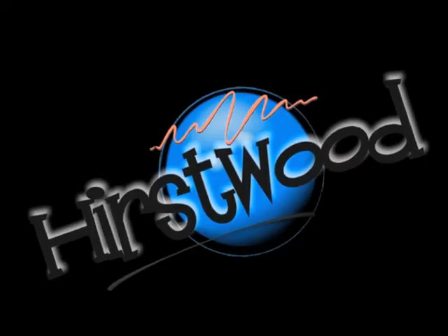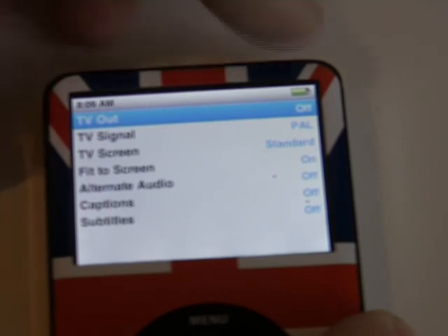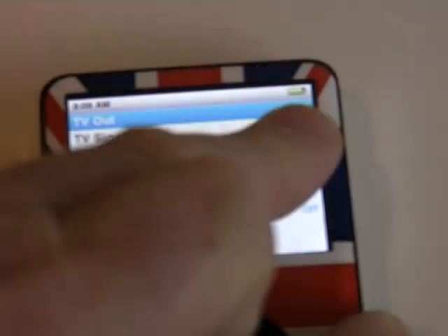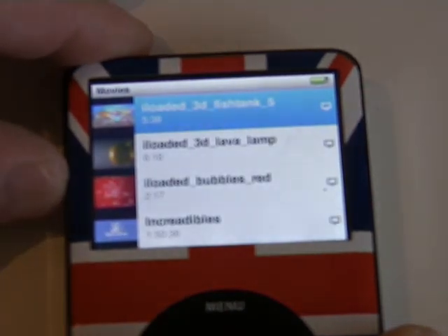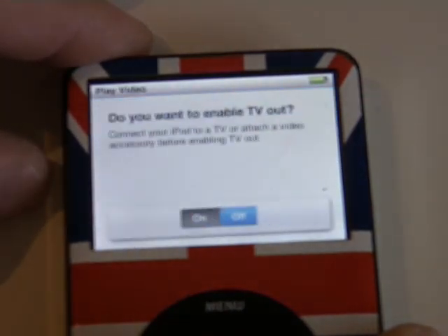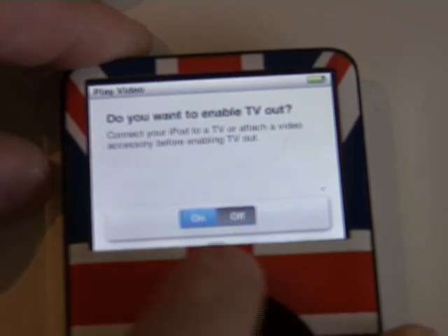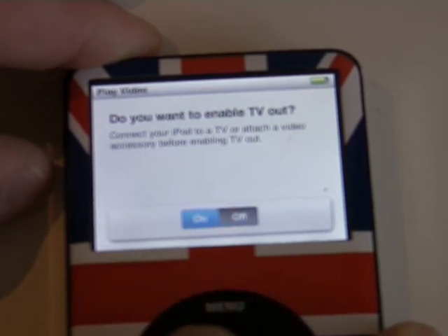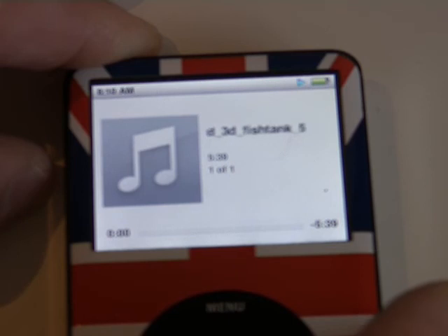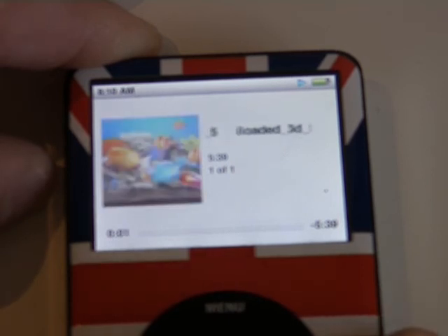Just one little thing — you need to set your iPod up. So, you can see there I'm in settings, and it says TV out, and up there it says off. What you need to do is go to TV out — it says ask or on. I put mine to ask. In other words, when the iPod plays a video, it's going to ask: do you want the signal to go out of the iPod, or do you want to play it on the screen? Do you want to enable TV out? I've just flicked it to on on the scroll wheel. It's a bit out of focus, but that's how you do it. And now when you press play, nothing will appear on the iPod screen, but it'll be on the Pico projector.